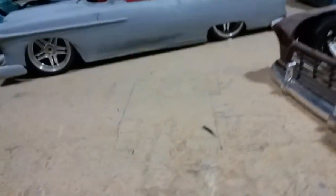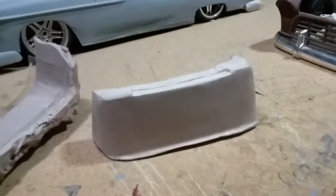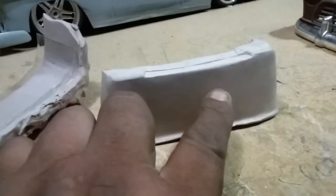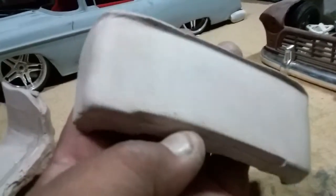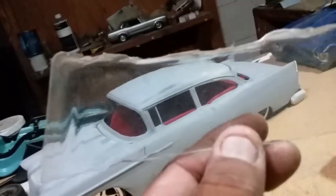That's what I've been doing for a long time. If you guys want to repair a windshield, you can do it — just glue the two halves back together, sand them down smooth so there's no seam, mix up some Bondo, and get that seam as smooth as possible. When you make your copy, make sure the surface is perfectly smooth. I wet-sanded it with 1,500, 2,000, and 3,000 grit for about ten hours on both sides. That way you can have a nice clear windshield with no scratches, pits, or holes.